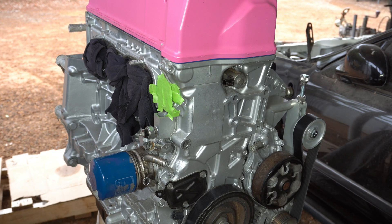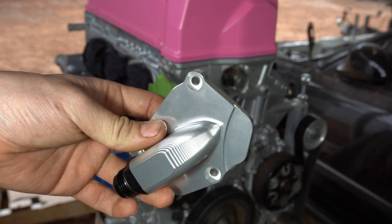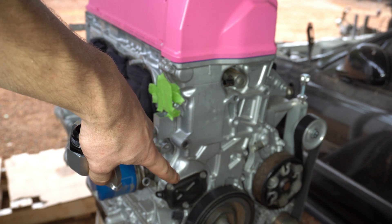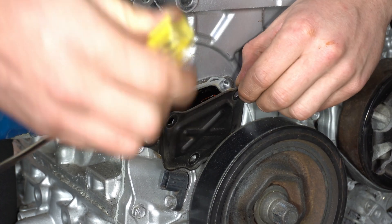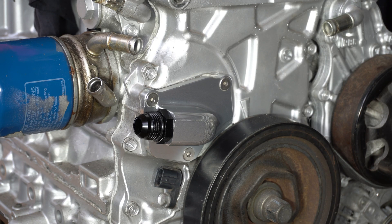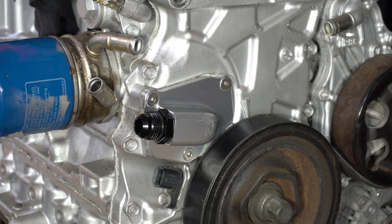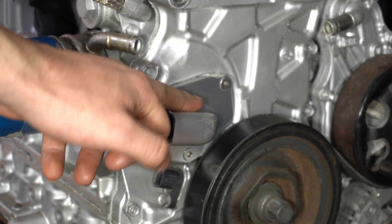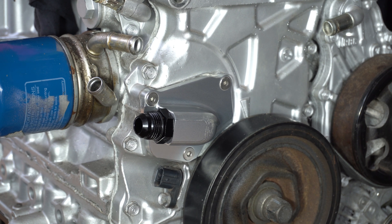While we've got time in this episode I'm going to be fitting this billet oil return line from my turbo — it goes right where that black patch is on the front cover. That's it on now. It was very hard to show on camera as I struggled a lot because the seal they gave me wasn't quite adequate, but this thing was very cheap. I've got an AN10 fitting to go on there and I'm very happy with that — hopefully it doesn't leak.